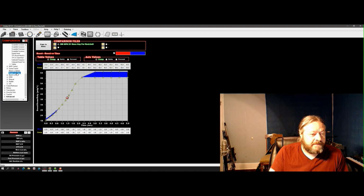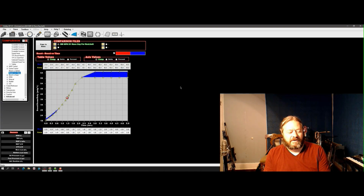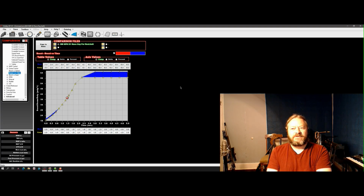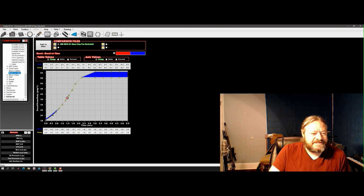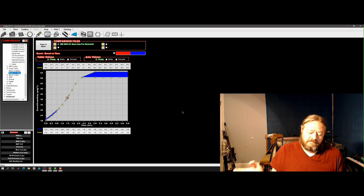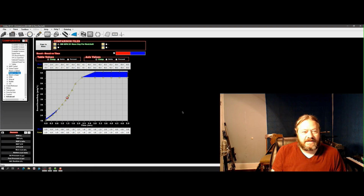Now, boost versus time. Your boost on the starting line is extremely important. We might do a video just about that at some point. It determines what's going to happen in the 60 more than your boost controller stuff in the 60, right? What you're doing at 0.3 seconds is cool and all, but if you don't have the start line boost right, there's probably not a change you can make. It's not going to respond that fast. So you have to get it right on the start line, as this determines a lot of how much power you're going to apply throughout the 60.